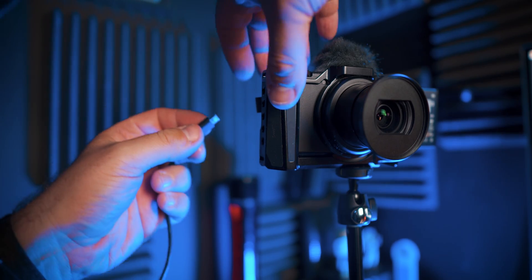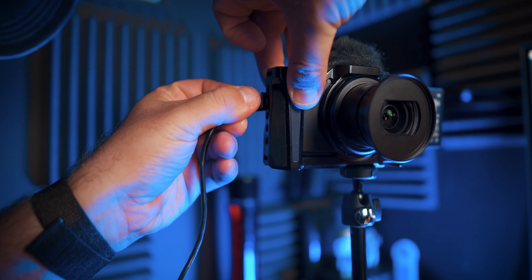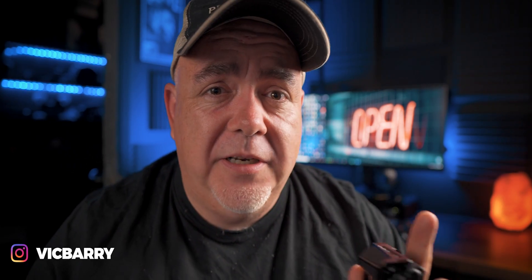Then connect the Sony ZV-1 via USB cable to your computer. Sony say use the supplied cable that came with the camera, which is fine if you've got it. But you've probably got a whole ton of USB cables lying around — some are longer and might be more useful. Just keep in mind there is an issue with USB and the Sony ZV-1, which I'll get to a fix for in a minute. Make sure the cables you're using are capable of transferring data and not just power, because some USB cables will transfer power and not data — you need data for this to work as a webcam.